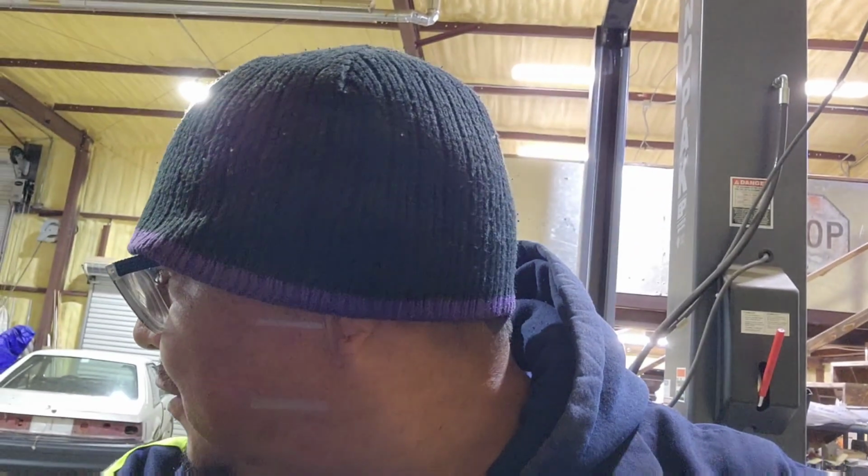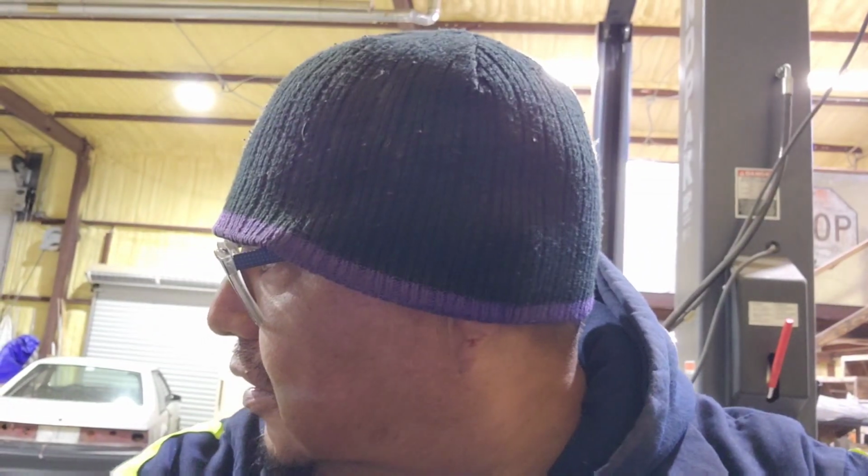I've been on and off working on different things all morning. I started on the engine, worked on a couple of things for that. The gray parts that are on the floor here, they needed to go on the Mustang that's outside. So I tried to bring it in. I couldn't start it, hooked a charger up to it. Worked in here for a bit, went back out. The charger screen was off, but it sounded like it was charging. The battery was not taking a charge though. So I changed the battery, I changed the charger, and I let it sit again for a bit. Worked on some more stuff in here. I went back out. And for some reason, the Mustang still wasn't cranking over, no power at all to the gauges or anything. So I got the work truck.